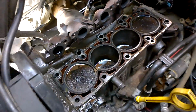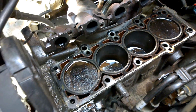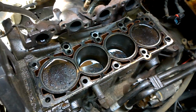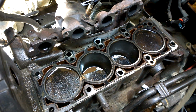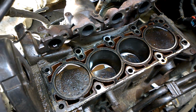And found out that cylinder number 2, see that one, has a leak. Actually, more than a leak. There's absolutely zero compression in there. I was getting between 175 and 185 compression on the rest of the cylinders, but zero on number 2.